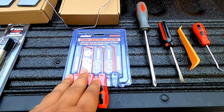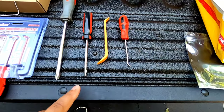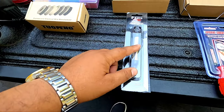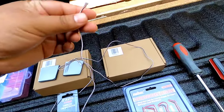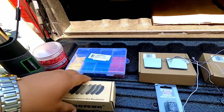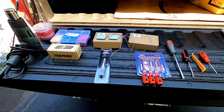Things you're going to need: some door picks — you saw them on the time lapse — these help pry out panels without marking them up, rather than using a flathead screwdriver. You could possibly need a flathead or Phillips head depending on the tabs. A pry tool. A wire tester. Extra wire in case you need it. The wire here is pretty long and has a tab to plug in, but I'm going to cut that part off. Some heat shrink in case you need it, wire taps, and a heat gun.